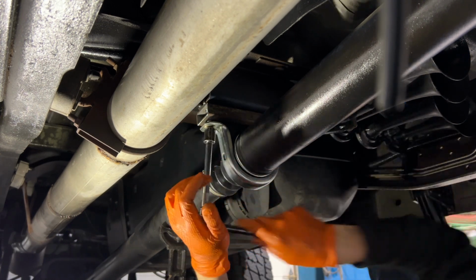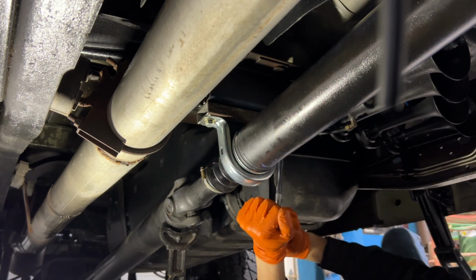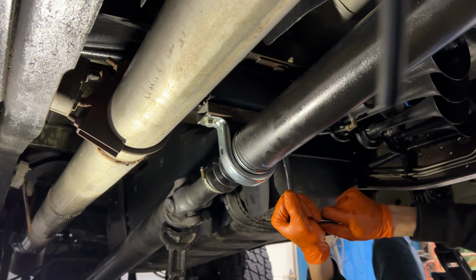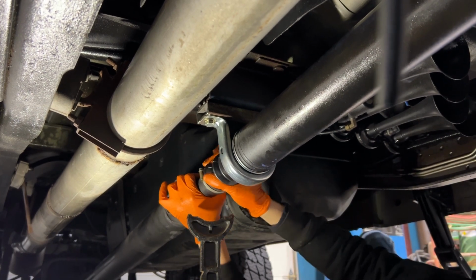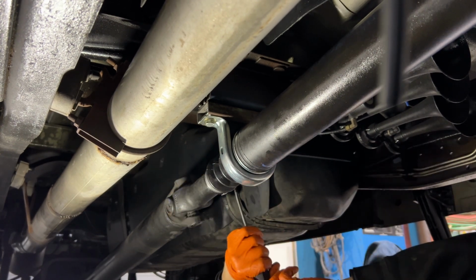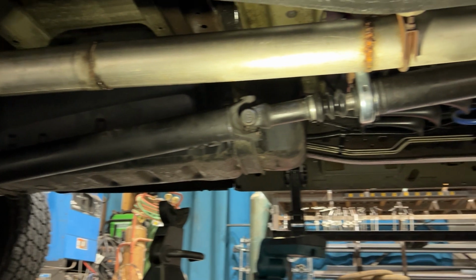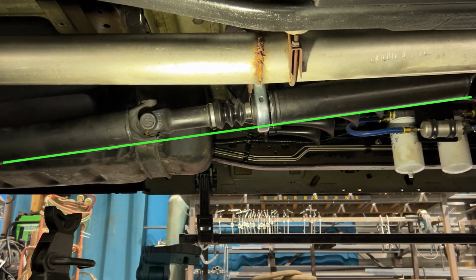Then I used a couple of longer bolts. I'll link what size and thread pattern those are in the description below, and tightened everything up with a little bit of medium thread locker. And that's what a carrier bearing or center support bearing should look like with the rubber tight. I tightened up that clamp and look at the angle on the drive shaft now. That is so much better. It's almost straight and you want it ideally to be straight.